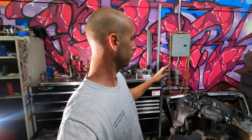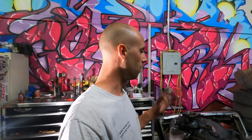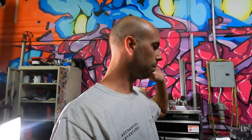Well, that was an absolute shit fight, and it's only because I don't know what I'm doing. But I finally got it set up, and everything is great. I'm in spec on the pinion preload. I'm in spec on the carrier bearing preload. I'm in spec on the backlash. So now I essentially have to tear it all back apart, new stuff all around, reassemble it, recheck it, seal it up, put my seals in, and I'm done. Ugh. And then I gotta do the rear.